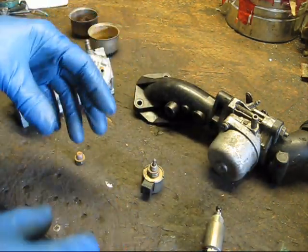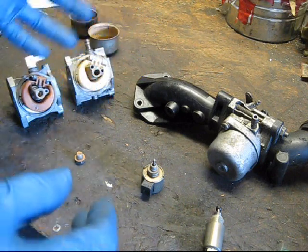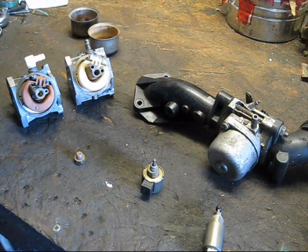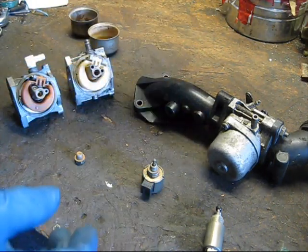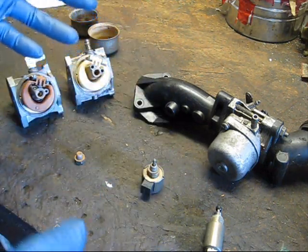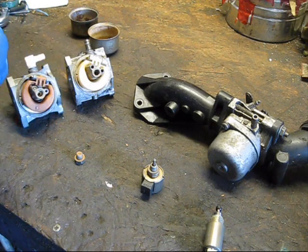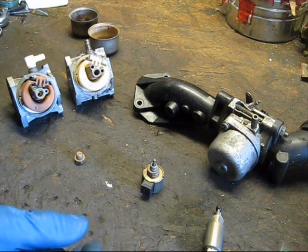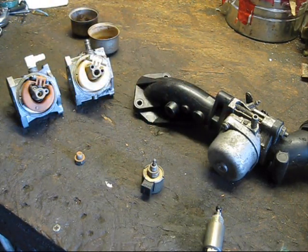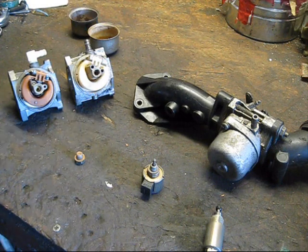Personally, I always fix the backfire solenoids because most of the mowers I work on I later sell, and a lot of the people that show up to buy these mowers have never driven a riding mower before and won't throttle down the engine when they shut it off. So when they go to shut it off and it backfires, since a lot of people don't know how lawn mowers work, that backfire is a massive red flag and either they try to talk you down on the price or they simply aren't interested in buying the lawn mower anymore. Plus backfires are incredibly annoying, and I personally don't throttle my engine down before shutting it off either. So I always make sure my backfire solenoids work. Hopefully this has helped you guys — that was the whole goal of this video. If you've got any questions, comments, or concerns, leave it down in the description below.